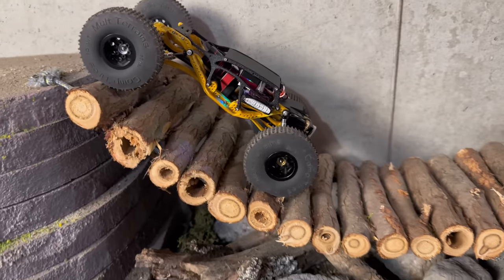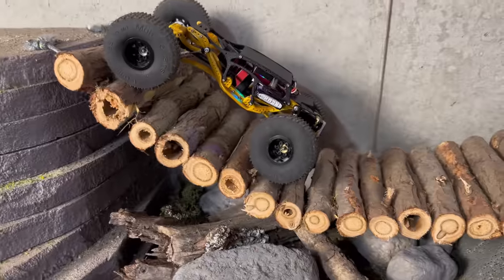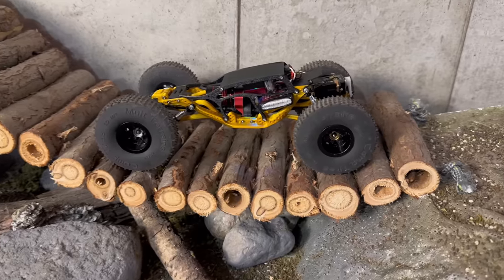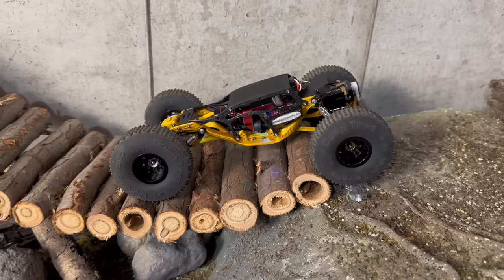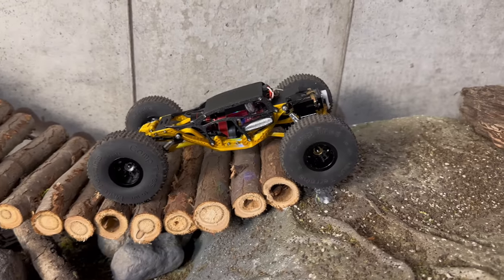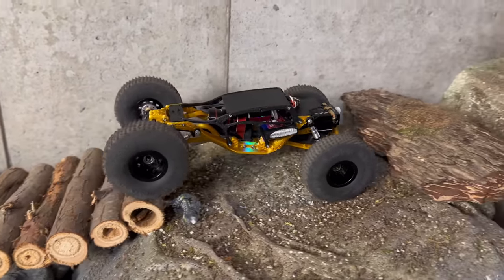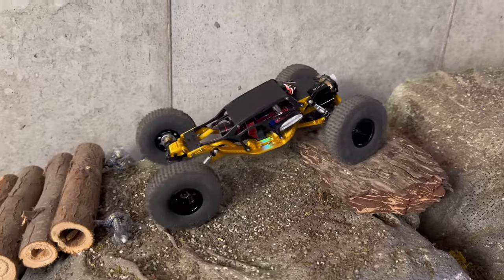This Texoma Slayer chassis, with the configurations you're able to do, I was able to just swap the motor around backwards. Don't have to take the skid plate off because it's a reversible design, so you can just flip your motor around no problem and it works just fine. So was able to just drop it right in and go. Pretty easy install.